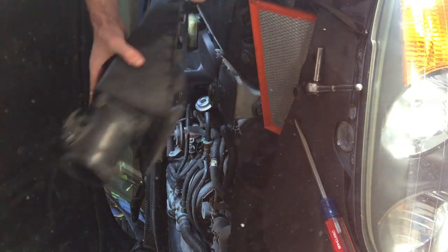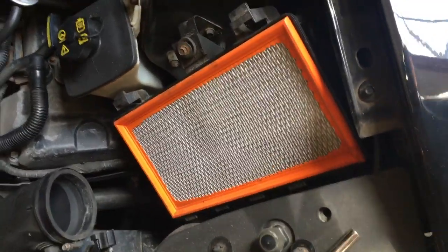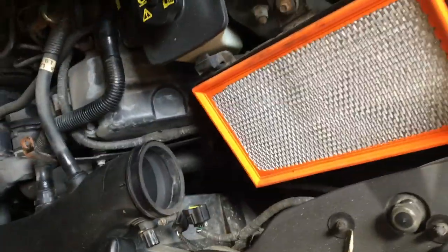I've got this completely off. Be careful — you don't want to harm the mass airflow sensor; they're expensive and sensitive. Now you can see this is where you get your air filter. This is really the right way to replace your air filter: unsnap the top, peel it back, and slide one in — that's actually how they designed it, with the bottom hooking into the tangs down here. I had already replaced this a while ago and it's not looking too bad, so I'll leave it in.